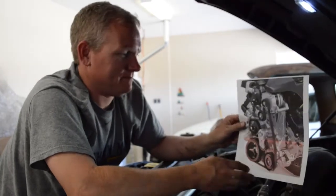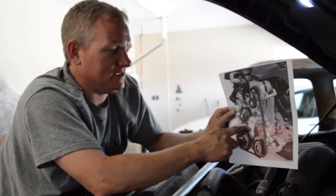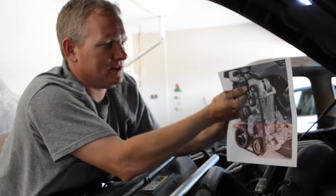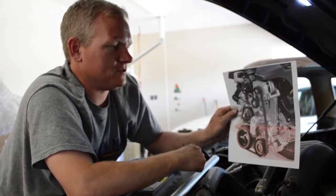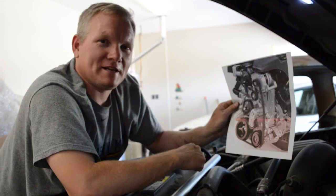So that didn't take much time. Here's the one that has the fan on it, there's your tensioner pulley. You get it loose, and you thread it through, keeping this one loose at last, and then loosen it and it'll pop right over the top. So it was pretty easy, pretty quick. Thank you for watching, and tune in next time.